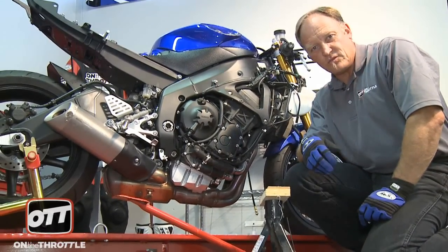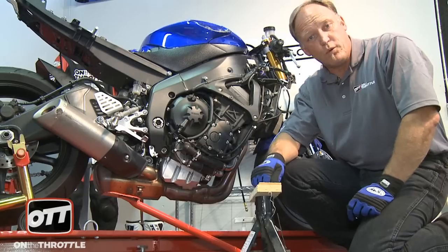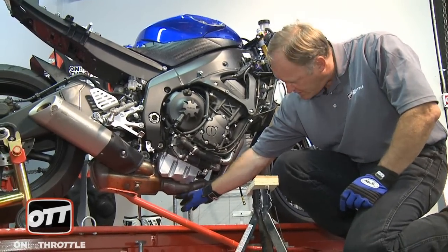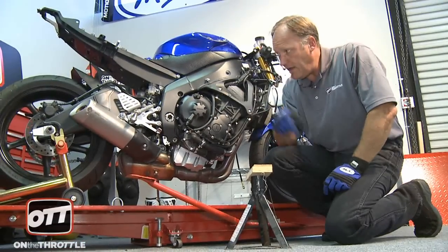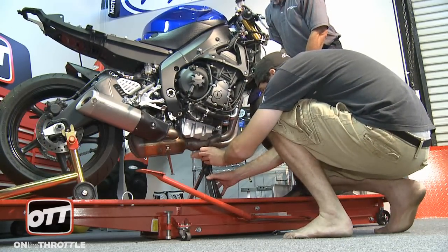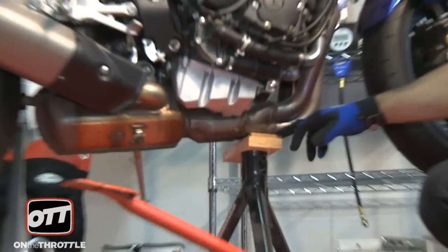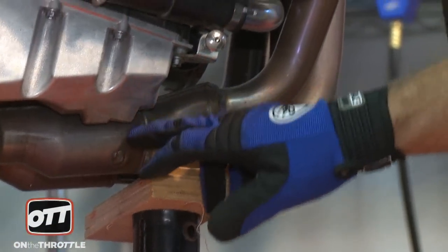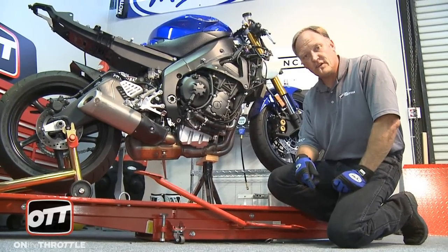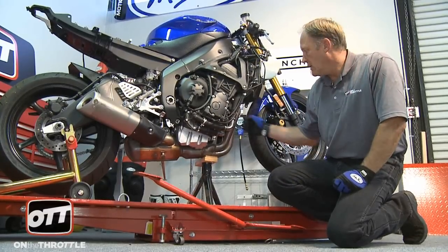Stock exhaust is extremely strong, there's no problems in using our block of wood and our jack stand to support it. So Chris, when I lift the bike up, he's gonna sit it right under here, right on the joint on the broadest part of the exhaust where the bike will be balanced properly and held no problem by a Pitbull rear stand. That took a little time to experiment with, and it's great to have two people because you can balance and hold the bike. You can see where we ended up — where the four down tubes go into their own section before the collector. Bike's rock solid. If you'd like to feel more secure, you could run a tie-down from the subframe to the bench itself, but we're pretty rock solid here.